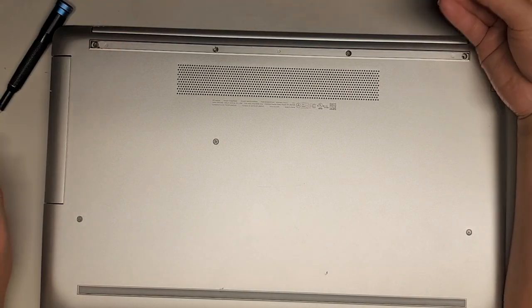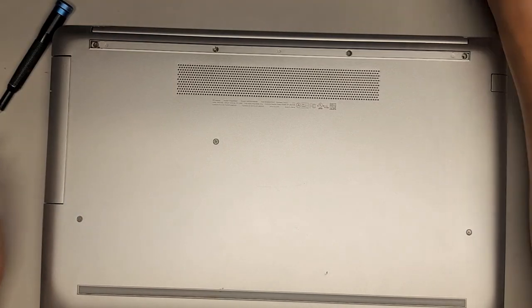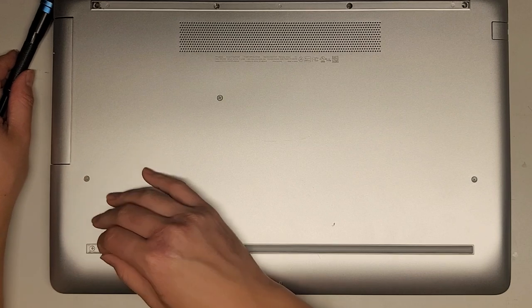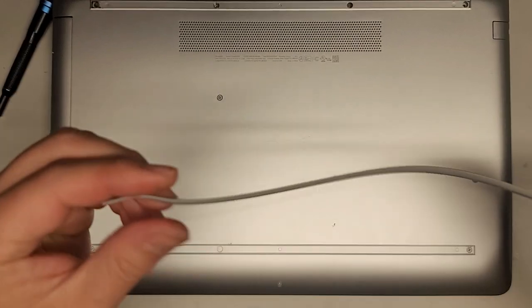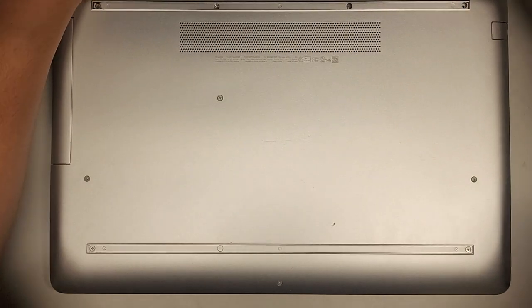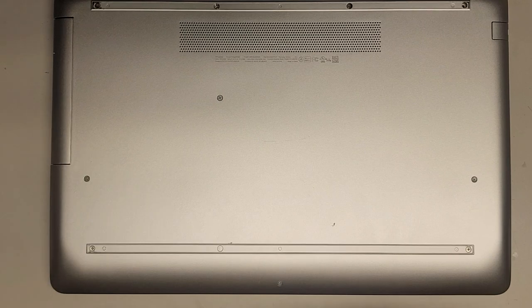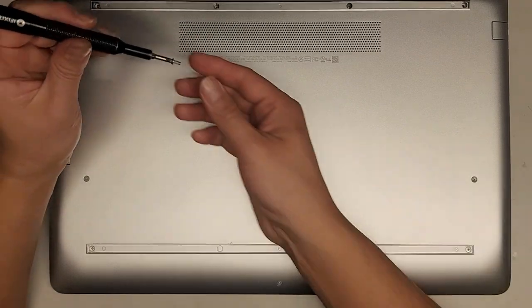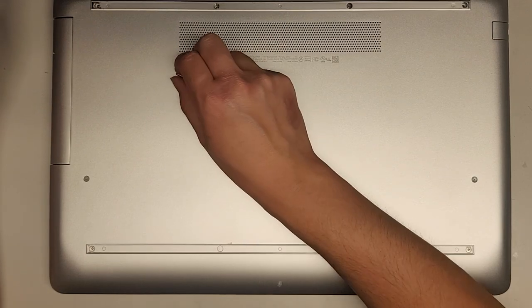You can see this screw is already broken off. We'll remove the rubber foot from this side as well. Make sure the adhesive layer is coming up and you're not just peeling out the rubber piece. Keep them in order because they are different size, shape, and length. Same thing with the screws — after I remove them, I put them flat side down on my desk in the pattern I remove them.